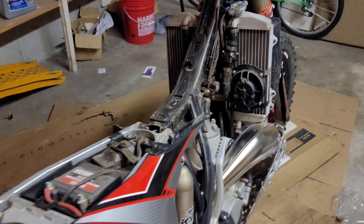We just got the other side on. I didn't record it because this side was really easy to slide on. I just went up from the bottom where the hose is — this one was very flexible — moved it out of the way, slid the radiator guard up on there, and bolted it down on the inside. Very easy. Then the front plate goes on just like the other side. In between shoots I also got the plastic shroud on this side — you have to cut the inside per the directions, which show you exactly where to cut. I always use a small butane torch to heat up a razor blade and cut the plastic, which makes it a lot easier.